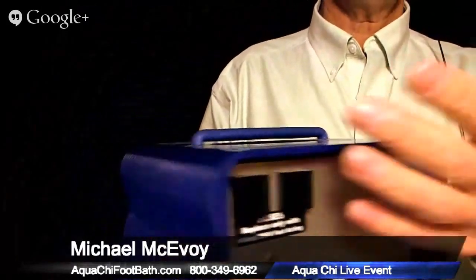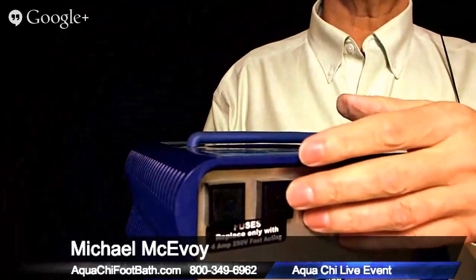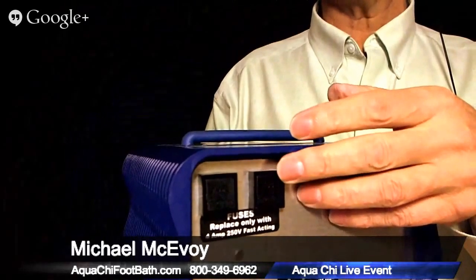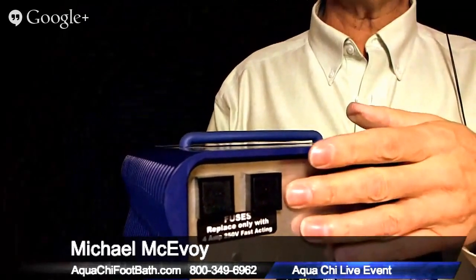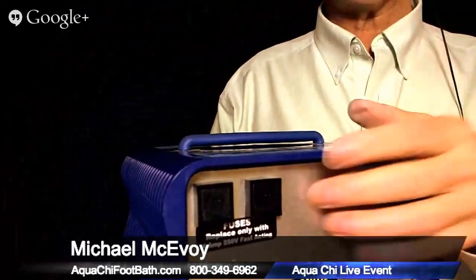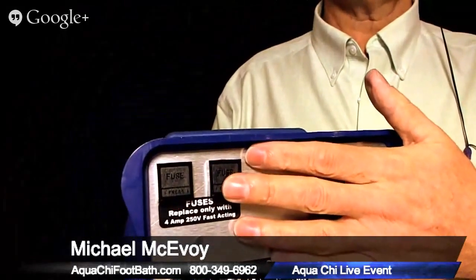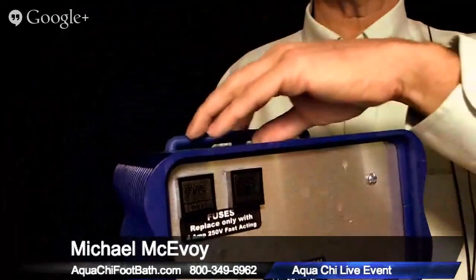So those are the two fuses. I always recommend replacing both of the fuses because sometimes you think it's only one fuse blown when both of them are. One looks visibly blown, but sometimes behind those silver caps on the fuse, there can be a break in the wire. And so the easiest way to avoid headache and strain is just to put two new fuses in when you do blow a fuse.